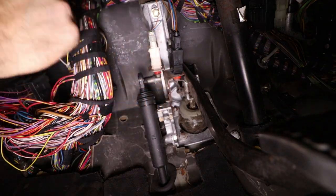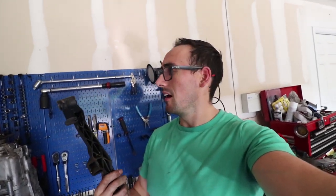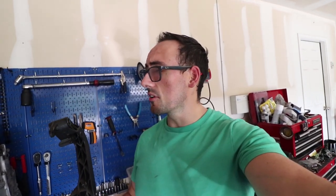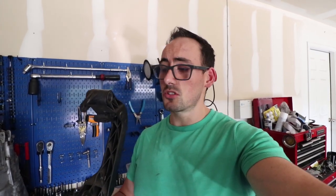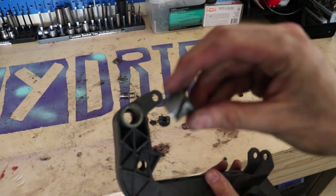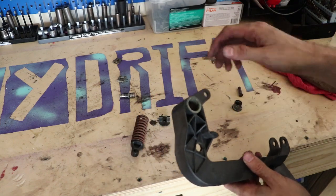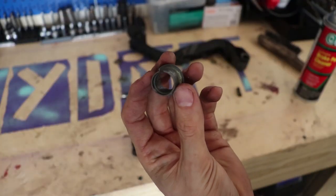I've got the clutch pedal out. Now that we have the master cylinder done, before we put this back in I want to address the bushings. They're not really good but I didn't have issues with the pedal before. If I was more patient I'd order the solid bushings, but I'm impatient. We're going to take these bushings out, clean them, and get them set up properly so it's one less thing to worry about. We'll lube everything up so we don't have any squeaks or wobbles. These bushings just slide out — they're plastic, they're slotted, and you can tell they're pretty worn. We'll put some grease on them and redo them.